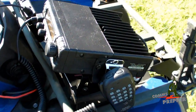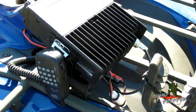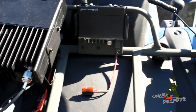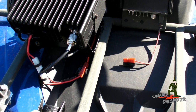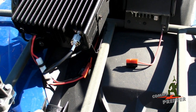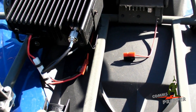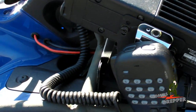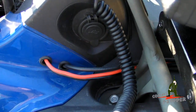So now I have two options if I need communications on the ATV. I could switch the antenna connection between the 2-meter radio or the GMRS radio. I used Anderson power pole connectors, so it's easy to switch the power between the two radios. How I ran all this cabling: I drilled two holes there and put grommets — we have power and the coax.